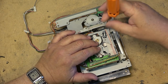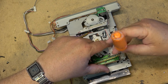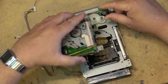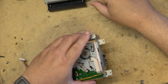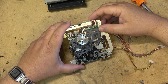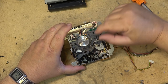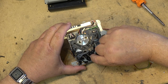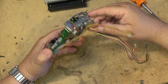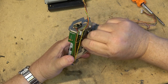Three screws hold it. This is where the little microscopic belt goes - the loading belt down here on this one. That lifts off the mechanism - one more plug over here for the preamp. Now we're down to the bare mechanism. The owner told me the little felt brake pads fell off and he tried to make his own - it looks like he's done one here. But it wasn't attempting to take up the tape when the unit was playing.